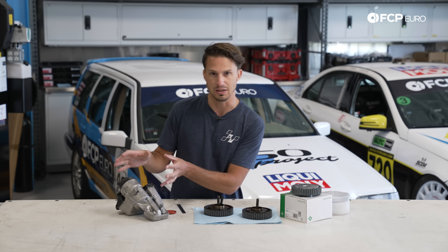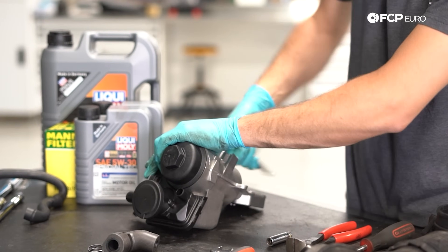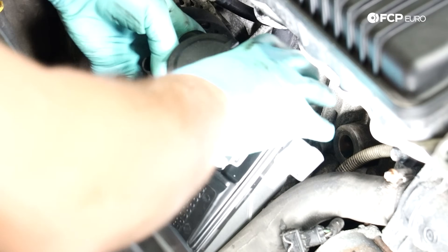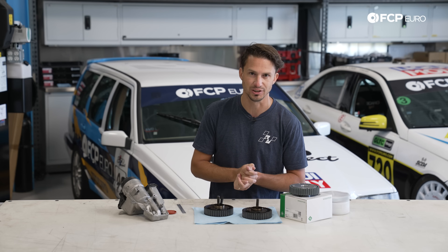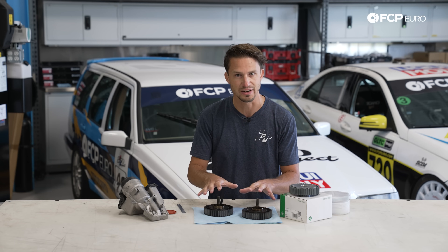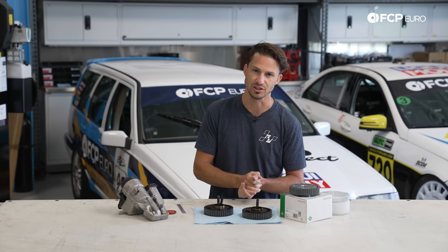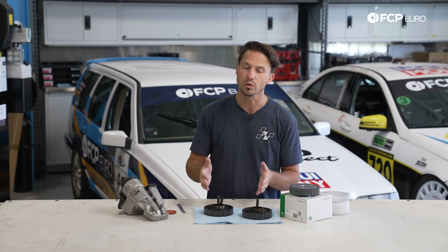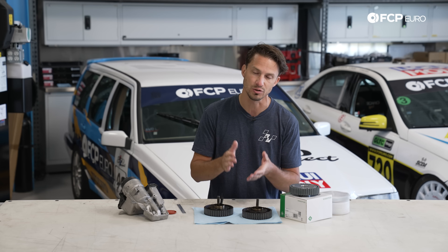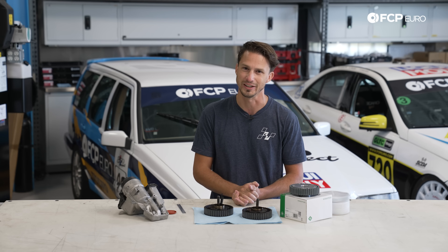If you have any questions about the PCV DIY, we'll add a link below that will go over exactly what you need to do to replace the PCV system so you don't pull those crazy vacuums and you don't ruin the seals on your engine. While we spoke mostly about the Volvo turbo five-cylinder engine here, this goes for any rotating seal in the engine. My best advice is whether it's a crankshaft or a camshaft, make sure you check those parts before you reinstall new seals so you don't have to take your engine apart twice.